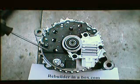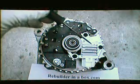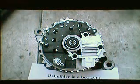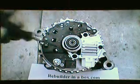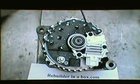Now we're looking at the inside of the alternator. Over here we have the rectifier where all the diodes are, the rear bearing, and this is the voltage regulator and brush holder assembly. You can see the three bolts holding them on — these three bolts are Torx head T20s. Take those three out.